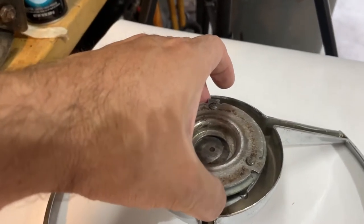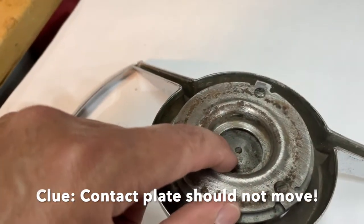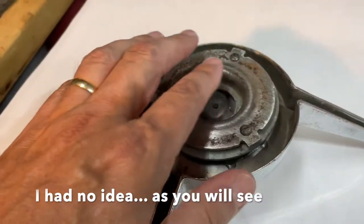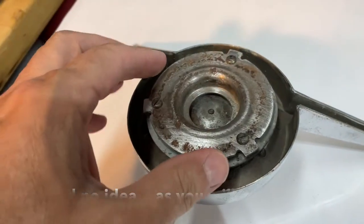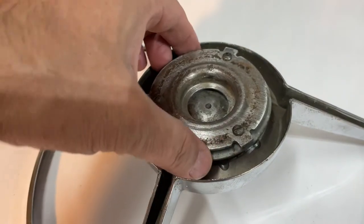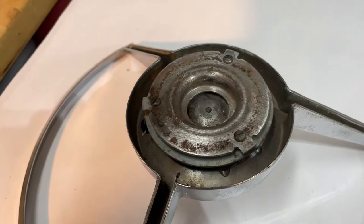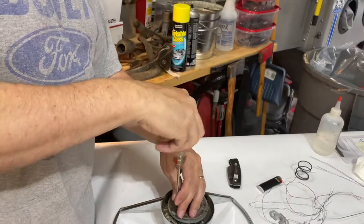You can see there's a bit of horn wire through the center that contacts this plate — it kind of moves here. This is a ring that retains the horn ring to the steering wheel, so there's no juice flowing through that. What's supposed to happen is when you move this a little bit it's supposed to hit. I need to clean up the contacts, so I'm going to take this apart and see what's going on.